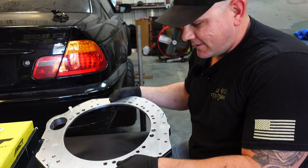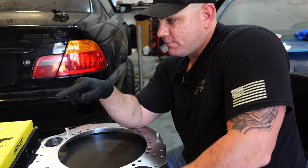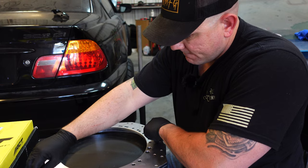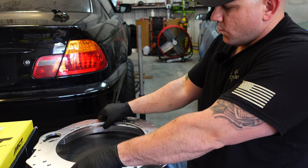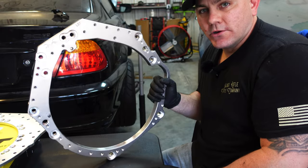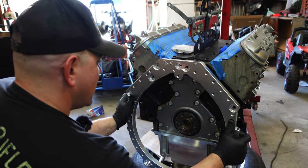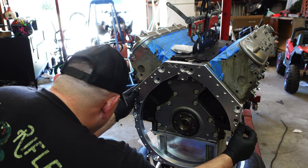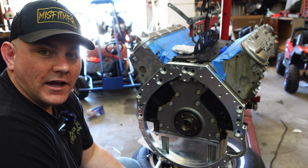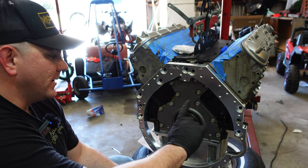Okay, now we're ready to move on to the adapter. This adapter is pretty much self-explanatory. We have these two pieces: our adapter flywheel and the automatic LS piece. These are two pieces — one is for your transmission side, we'll put that to the side, and one is for your motor side. So this is our LS side and it goes on the back of the block. These little dowel pins on the left and right of the motor just slide in like this. That easy. The most simple way to LS swap your car and use the same transmission — get one of these adapters. Super simple.